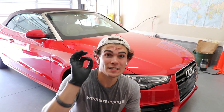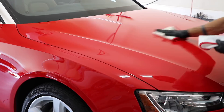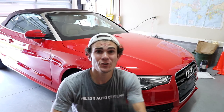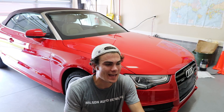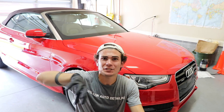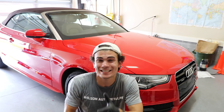You want to make sure you're dispersing it evenly because this is kind of like a layer of glass you're putting on the paint, and it can get uneven if you don't apply it intentionally and correctly. Make sure you go over in a crosshatch pattern many different times so that you're applying it very, very evenly. So here we go — this is what this looks like. You guys can see I was doing that quickly — even in real time I was removing it very quickly, because if I let it dry it'll dry unevenly and look splotchy.